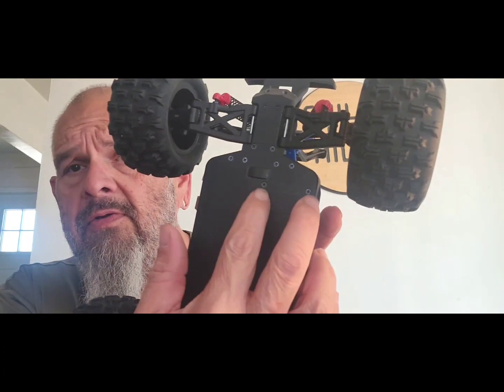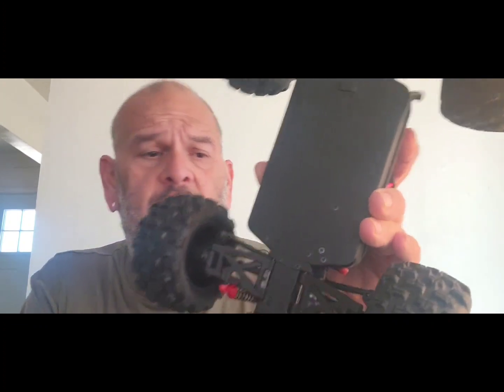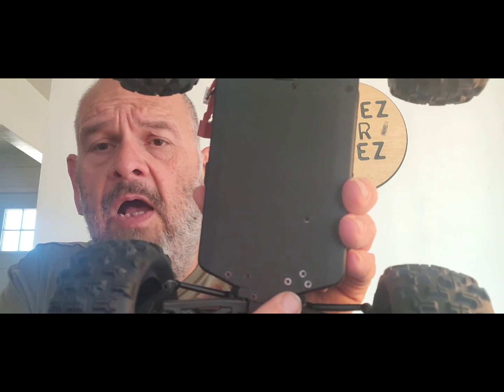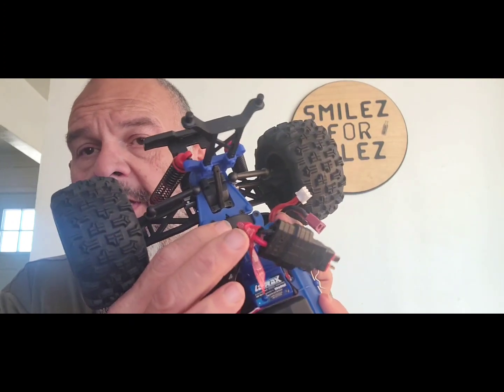It's all Phillips screws — very minimal. You've got mounting points for the motor mount. You can take apart this whole front section: a few screws here moves the motor mount out, and screws here remove the servo mount. Same in the rear — this whole section comes off so you can change the gearing. You can get metal pinion and metal spur/drive gears in steel from Traxxas as well. Down the road this is going to become my new mini basher.